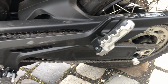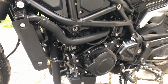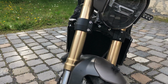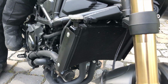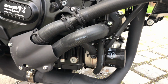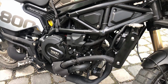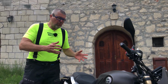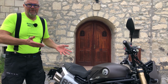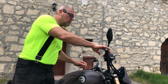The engine from the technical side is absolutely the same as it was in the 725S model 2 years ago. It's a 754 cubic centimeter inline 2, a relatively big inline 2 engine, but the power and torque output is absolutely not overpushed. In the real field we can say it's a weak engine, because 76 brake horsepower and 67 Nm torque is not much today, even in the Euro 5 era. In Europe the power output is only this amount, and it seems to be a weak motorbike, but in real life, when you are sitting on it and riding it, it's not weak.